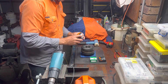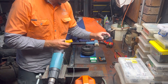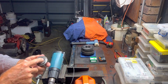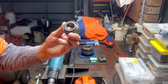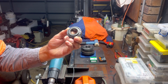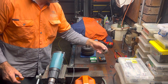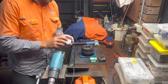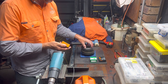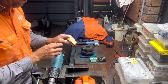I always just assemble them with the oil that they're going to run in, so they're all ready to go. These particular bearings - the ones that came out - are Timken 33205s. The X33205 marking is on the race. That's the standard duty Timken, nothing wrong with it, it's a good bearing. These come with the Ashcroft kits and I've pulled these out of LT230 standard intermediate gear sets.